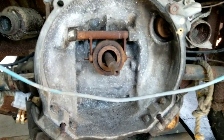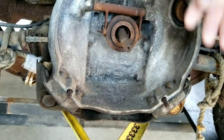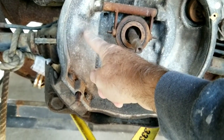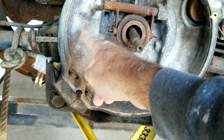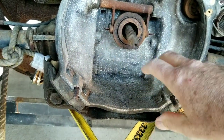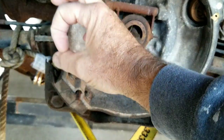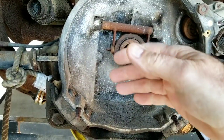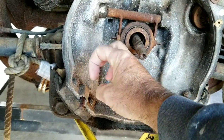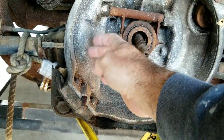This is what the 12-volt case actually looks like. There's a little bit of difference — there is a little bit more clearance. On the 6-volt side, you may need to machine just a little bit right in here. You might want to assemble your clutch up and put it on. Make sure that the clutch springs — if you have the early style with the round springs going around — if you have the late style with the diaphragm ring on it, you're probably okay.